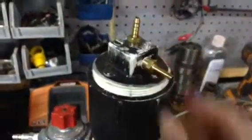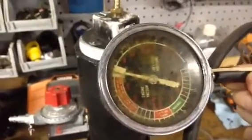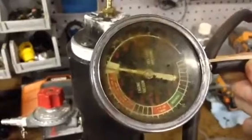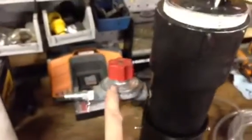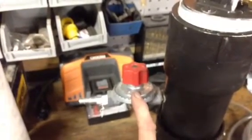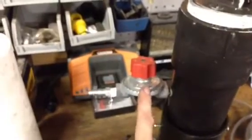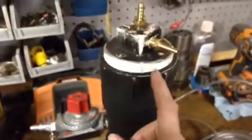This is another piece of three inch PVC pipe - it's like a clean-out drain. This is the lid that screws on it, and then I put these nipples on. On one nipple I have this pressure gauge. You don't want to do more than one pound of pressure if you're testing the evap system - two pounds tops if you're smoking a motor looking for vacuum leaks. This needle works really great. The main thing is you will have to have this regulator - it's a propane regulator I got off eBay, roughly 12 to 17 bucks. It's adjustable and does 0 to 10 psi.